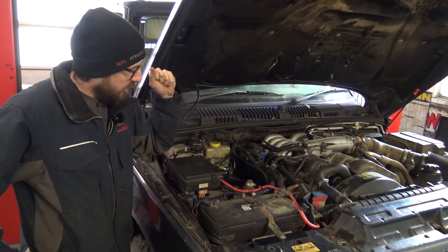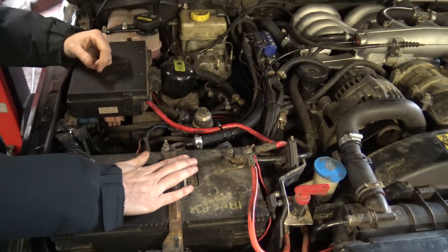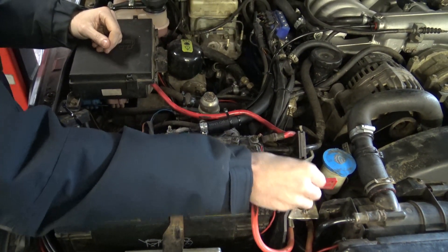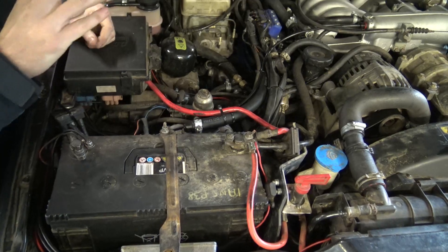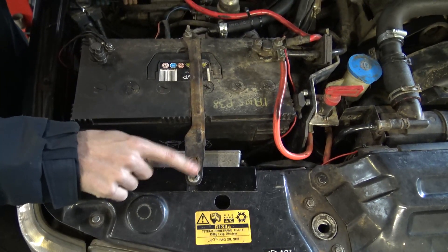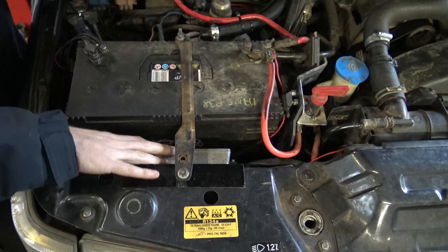Under the bonnet of my Range Rover, the vaporizer relocation has gone really well. As you'll notice, there's no big bit of plastic behind the battery anymore. All the battery clamp still remains though, and the original under tray for the battery is still there. Had to retain this side because I didn't fancy making an extra bracket for my isolator switch for the winch right now. So the LPGCU that was here is now in front of the battery on a nice little bracket that picks up off the battery clamp bolt, so it's really easy to remove. The cable's long enough to just slide it out on top so I can access bulbs and things behind here nice and easy.